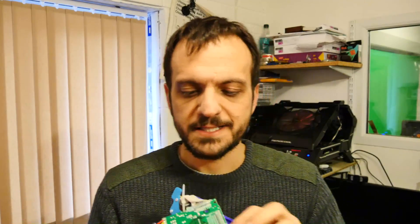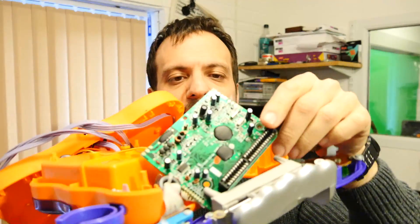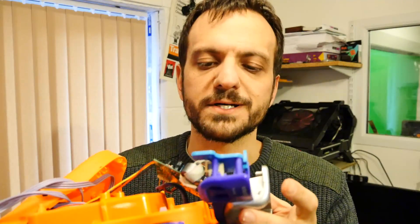It developed a fault and I basically opened the PCB to find the battery had leaked into it, and it was a kind of cheap design. You can still smell it - it smells a bit weird, acidy. So I've cleaned the PCB, reflowed it, fixed some dodgy looking caps, and frankly even looking now I can still see some crud on there. I just couldn't get it to work stably.